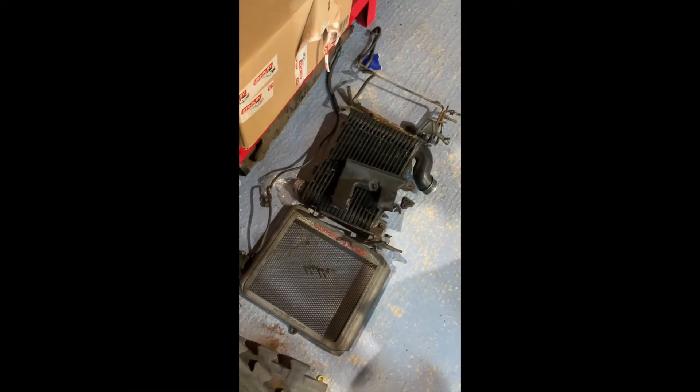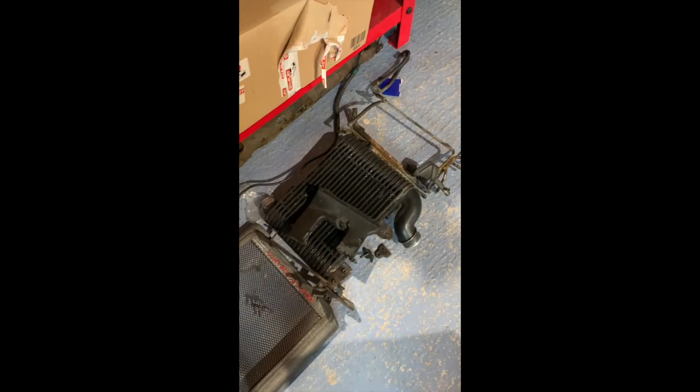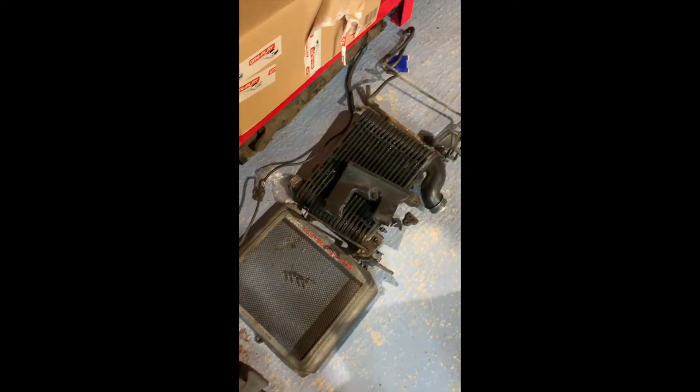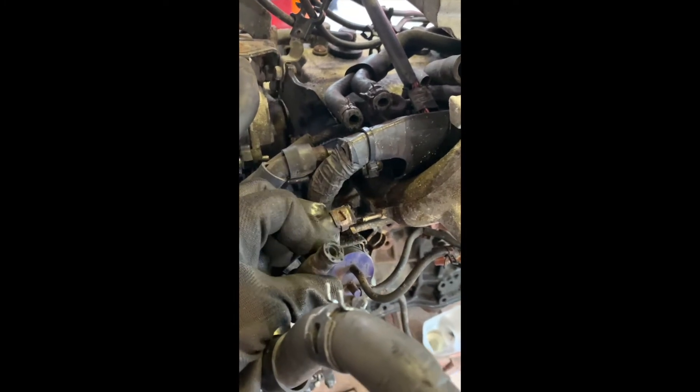Welcome back to the blog — today's the first day back in the garage after about five weeks. As you can see, I've managed to get the intercooler fin guard off, the intercoolers and brackets, the air hose, and the lines that go down to the power steering pump on the back of the manifold. A lot of these clamps have rusted over time and most of them broke, so these will be jubilee clip replacements in the future.